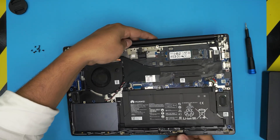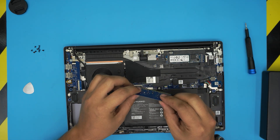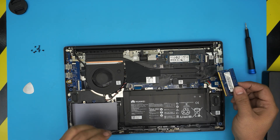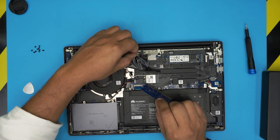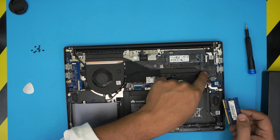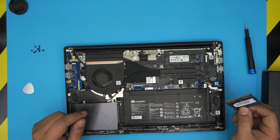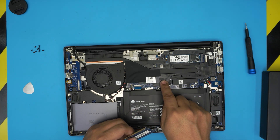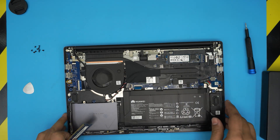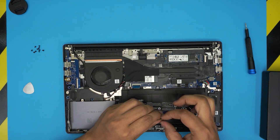Down here you can see the whole thing. There is no RAM — the RAM layout and thickness look like this. There's an M.2 SSD drive right there, and over here there's a Wi-Fi board. There's nothing else — absolutely no RAM DIMM and no space for a RAM DIMM to go in here. The RAM memories are soldered on the board on this side, and the other memory is soldered on the other side of the board. There's absolutely no space for any RAM DIMM because the RAM DIMM socket is too thick to fit in here.